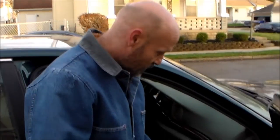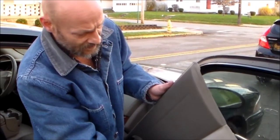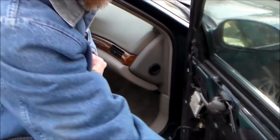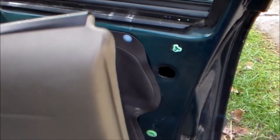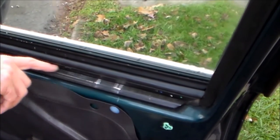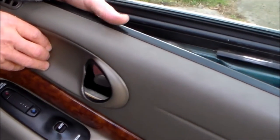Okay YouTube. Now what I'm going to do is show you how to put this door back on. What I didn't mention to you is the reason why I popped this one off - because this light on these Buicks has to come out. There's a screw right behind it. There will be a Phillips screw right behind there, and that will go into this plastic grommet right here. That's where that will go. So make sure you check that before you yank it off. Mine was already out of there, that's why I went ahead and yanked it off. So right through here you'll see this piece of steel, and this piece of steel has to go right down in that groove there. But first we got to put our door handle through this hole.